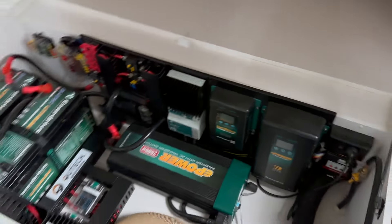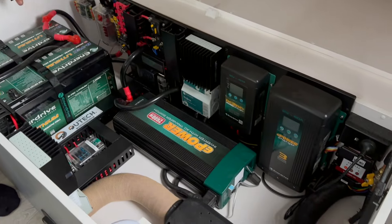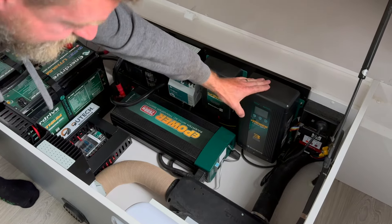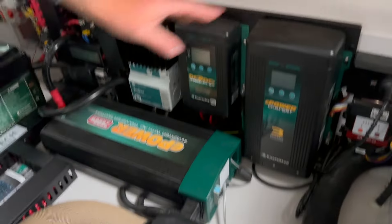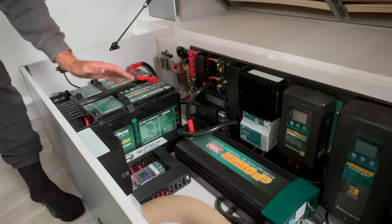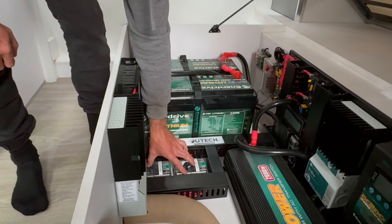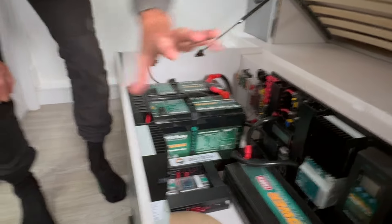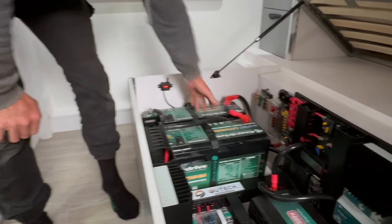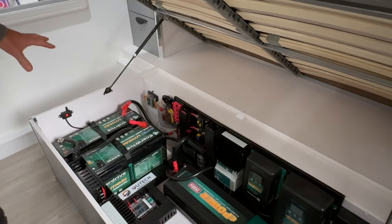So as you can see here, the system came with a 45 amp Tri-Star, a 40 amp Enerdrive DC-DC, and a 60 amp AC charger. We've added in another 45 amp Tri-Star and Simarine monitoring, with full isolation and fusing as per standard for the solar. The two 200 amp hour batteries were already here, and that's why we haven't had to enclose and vent them - that was already installed from factory.